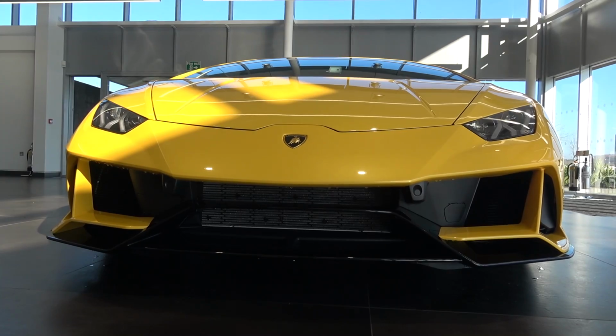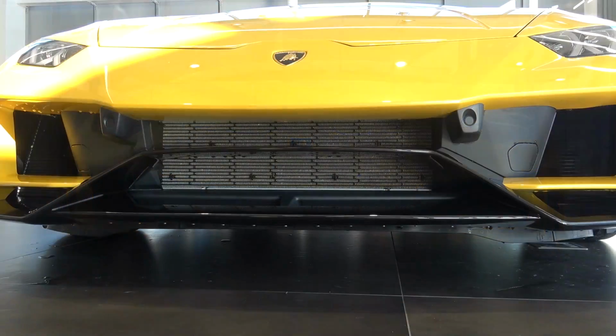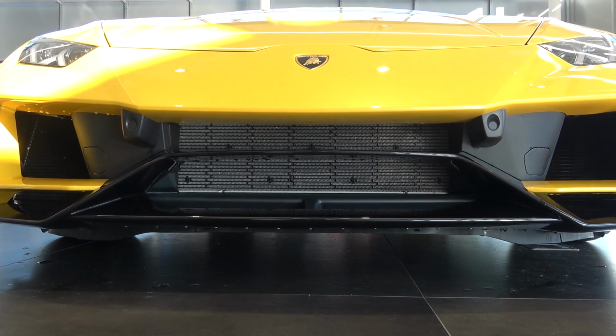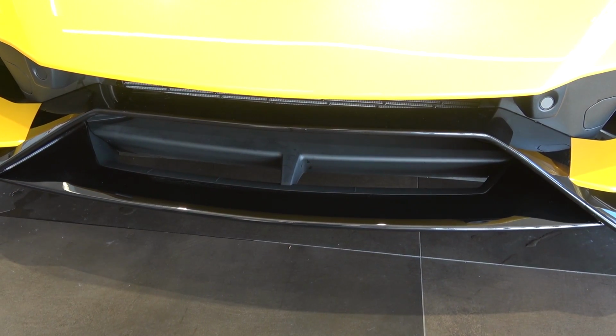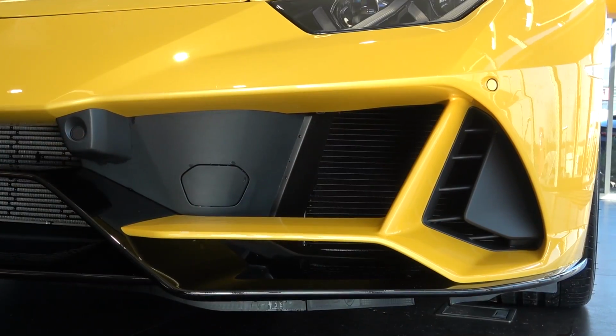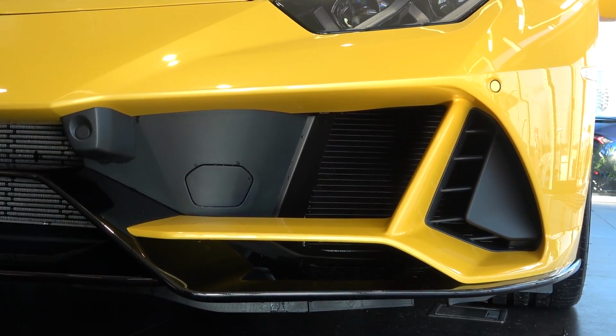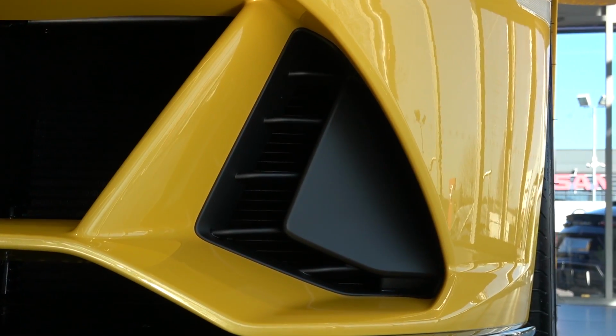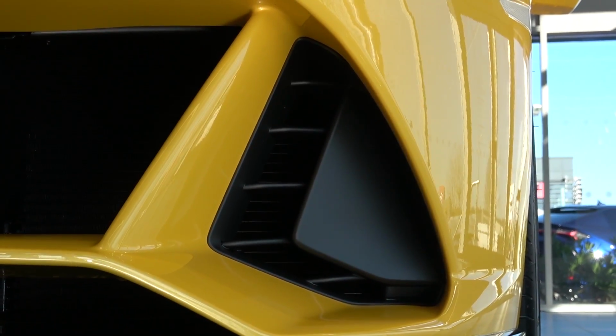The front has very noticeable changes. Centrally, the upright struts are now connected horizontally. Below, new dual vents send 2 channels of air under the car to the waiting diffuser, enhancing stability. Moving laterally, the side intakes now come with a Y-shaped panel that improves downforce. These also facilitate a greater amount of air passing through to optimize lateral aero around the disruptive front wheels.